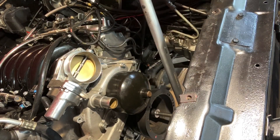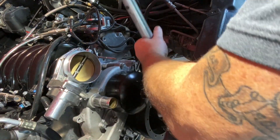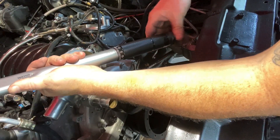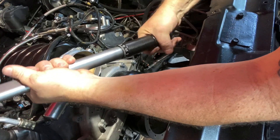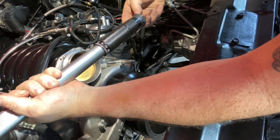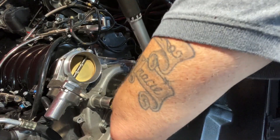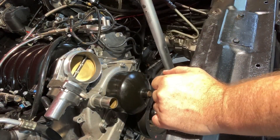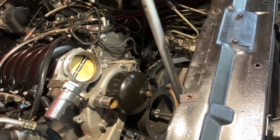Definitely if I'm doing an intake where it stages and you have to do it in a pattern, I do it in stages. Even the throttle body — it's all just documented. It just takes a minute, why not? 205, 210, there's 220, 236 — right there. That's gonna be your number. The stock bolt has a torque-to-yield angle. So there you go.